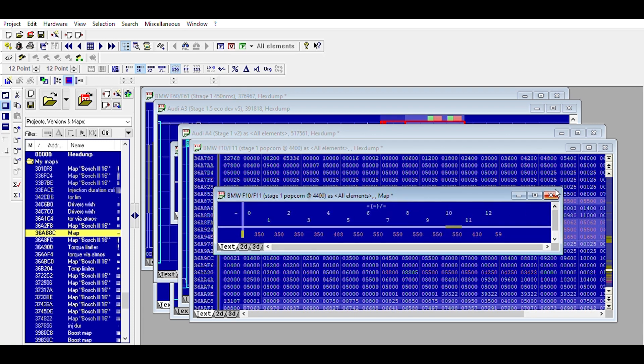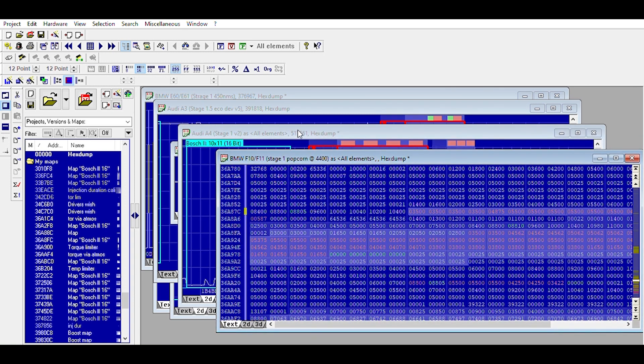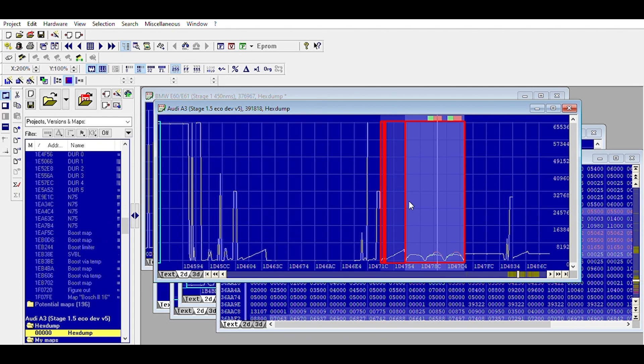That's why we can allow these things on an automatic box. But on a manual box, you have to be more considerate, because people like to just punch it and the car won't automatically downshift back into a better RPM range. So that's basically torque maps.